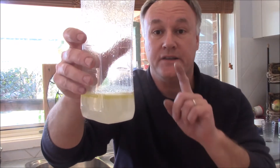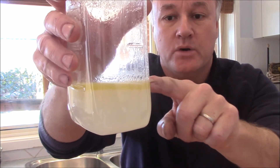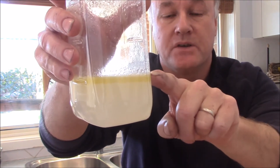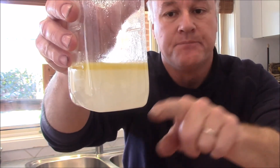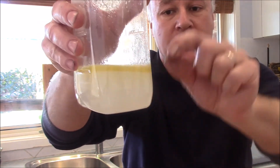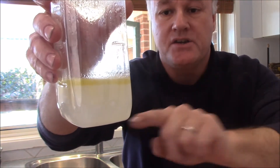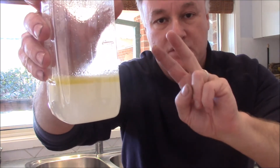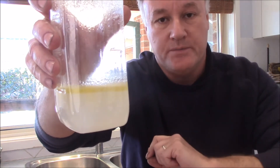Okay, that's only 30 seconds, but have a look what's happened — all the water has sunk to the bottom and the oil sits on top. That's because of liquid density. So if we have water in our oil, where do you think it would be in the sump? The water's going to be in the bottom. The oil will be sitting on top. So when you pull the dipstick out, you might just get some oil on the dipstick — not an indication that there isn't water in the bottom. There might be two little experiments we can do to prove whether we have water in our sump, which would be an indication of either a blown head gasket, cracked cylinder block, cracked head — the list goes on.